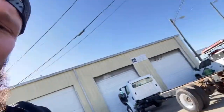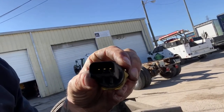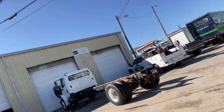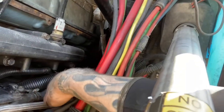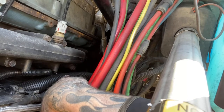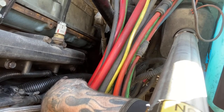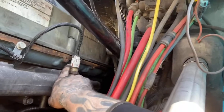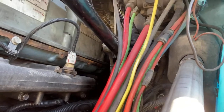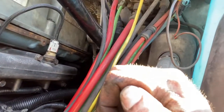This is what it looks like right here — it's a little three-pin sensor. It's a 33 millimeter deep well socket that gets this bad boy out. It's back here, almost parallel in line with the intake manifold on the back side of the block. You kind of got to wiggle your hand back there and you can get the socket on it and pull it out. It's got a safety clip on it — push the safety clip back, pull the harness off of it, and then you can get to it and pull it out. It's pipe thread, so pretty easy to come out and go right back in. Thanks for watching, follow us for more.